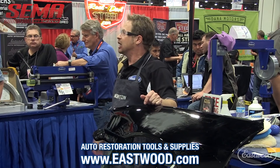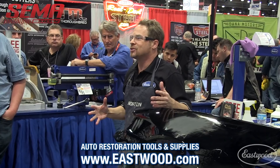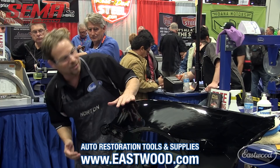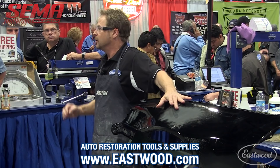I think I'm sanding through with my 1,000 grit. I'm nervous at this point because this is a show car and I've got a deadline — just like the TV shows. I don't want to mess this up. I've got three coats of high-solids clear and I'm doing a lot of steps. I do not want to burn the paint.